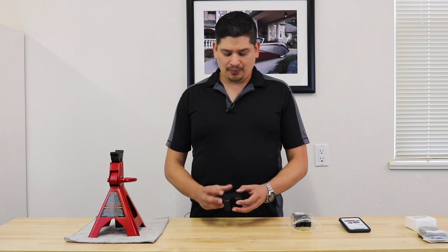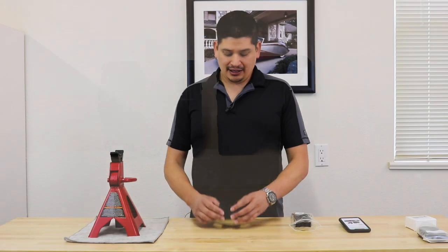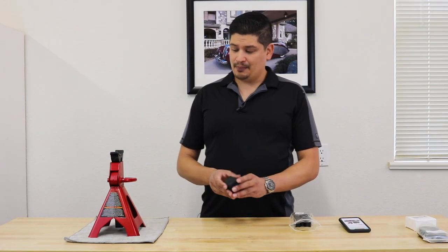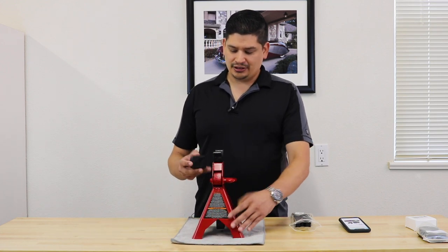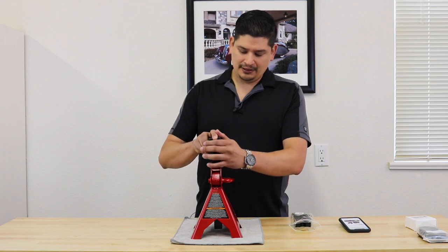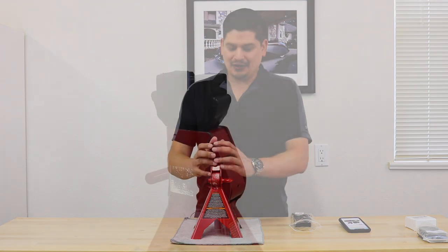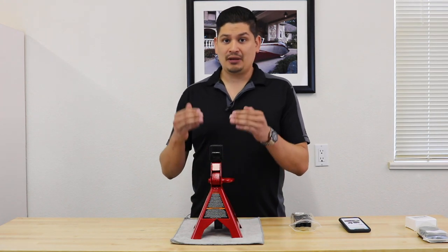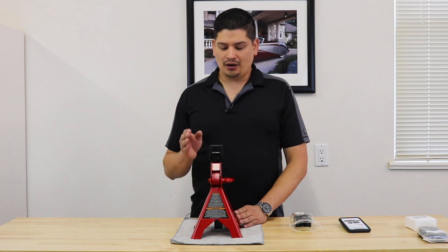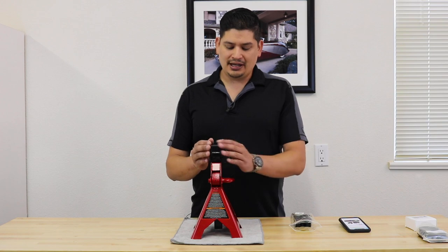Let's go ahead and look at it up close — that looks pretty great. So let's put it on our jack stand. This is a three-ton jack stand and it fits really well — like really well. My biggest issue with jack stands in general is the metal-to-metal contact, and the jacking points on cars are usually a line of metal designed to sit on there.